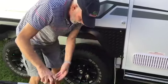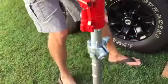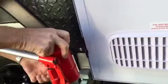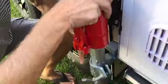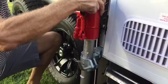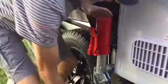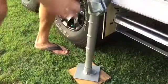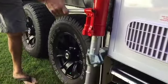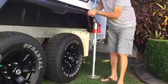But I'll just show you how the jack works. All you need to do is attach this attachment to the jack, and just line it up — got to let it down a fraction. Line it up with the groove so that it comes up under there, like such. Just make sure you're positioned properly, up and down that way and that way properly. And then just start jacking. Keep jacking until you've got the wheels off the ground.